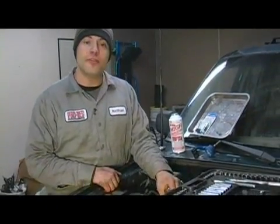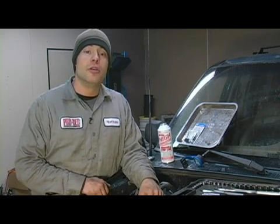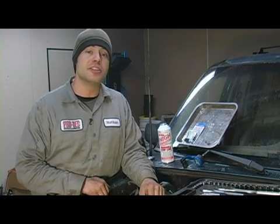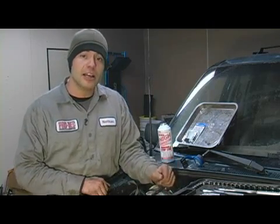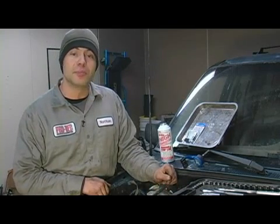If your air conditioning is only working slightly, you will still have some refrigerant trapped in the system. You're not going to be able to just remove the fittings and take the refrigerant out. It's a felony and carries a prison sentence and a very stiff fine. Most repair facilities will still pay you for your R12. They will charge you for the AC service if you have them refill the system on your own. But venting it to the atmosphere, if you just unscrew the fitting and vent it to the air, is a felony. So this process you can do alone if your system is completely empty.